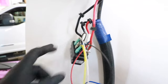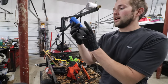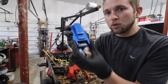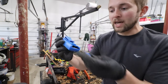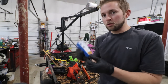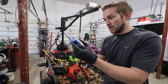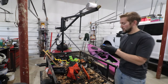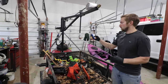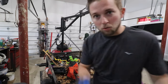Now let's reconnect the battery and give it a test. The only thing that kind of annoys me with these remotes is they take a special battery — a 23A 12-volt battery. So I'll probably have to order a couple extra of these. It is nice that the kit includes two remotes, but you've got to make sure you shut these off, otherwise you're going to go through a lot of batteries. Let's turn it on and see if we have everything wired in the correct orientation — starting with out, and the winch line is going out and in. That's going to conclude this video. Thanks for watching — catch you on the next one.